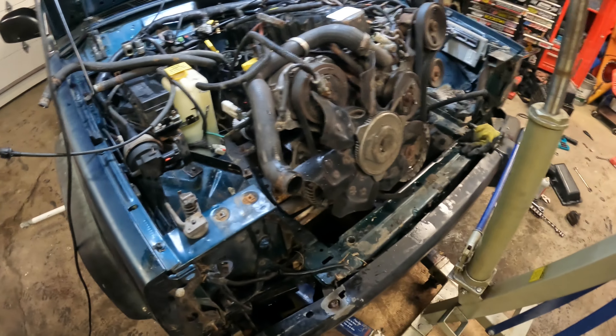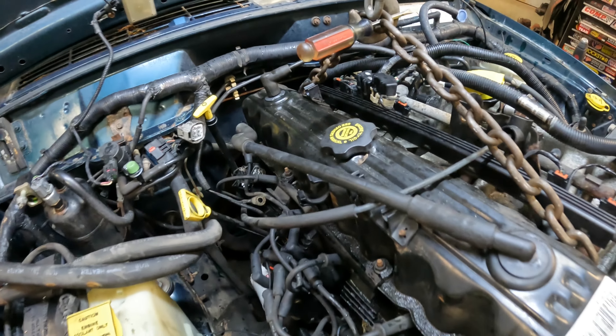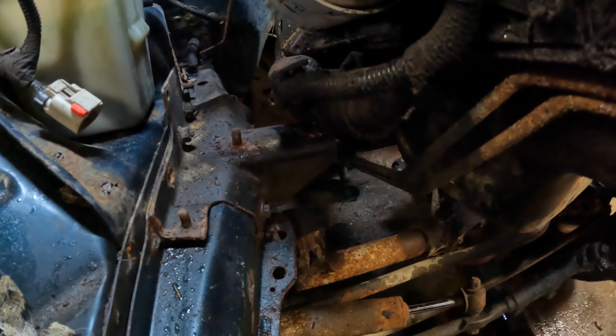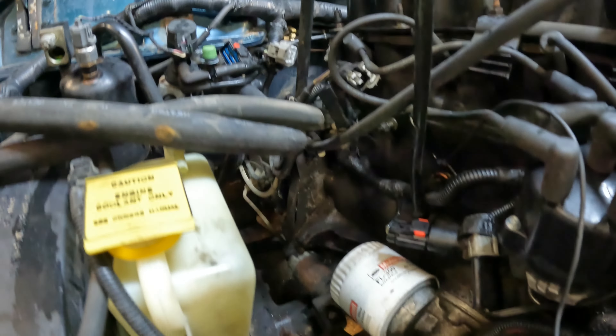Before I tug it out I do a double-check that there are no cables I possibly missed. I pull the assembly forward and up — I can see I'm just barely going to snake by on the exhaust manifold. On this side, removing the engine mount allows just enough clearance for the starter to snake by, and I continue to go up and out with the assembly.